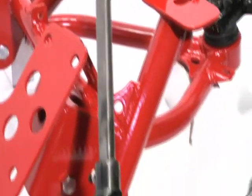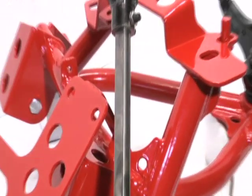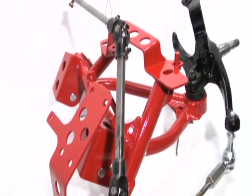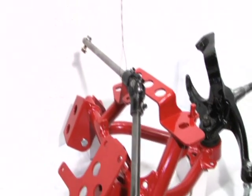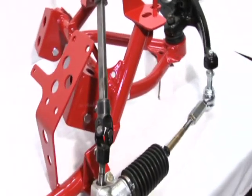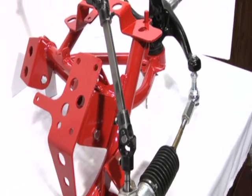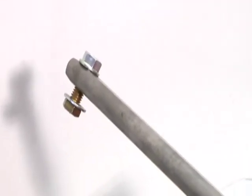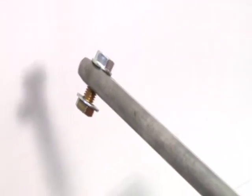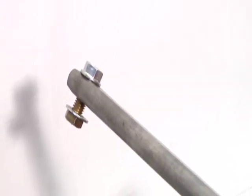We're using a 3/4 inch DD steering shaft, which is going to give you maximum header clearance. It's very low profile, yet very strong. This rack kit and steering shaft is going to give you about as much header clearance as possible on a 3rd gen. Really opens it up for you. Now on the top end of the shaft, it's drilled. This mounting hardware comes with. That slides right into your factory connection. Just bolted in place. Everything is a direct bolt on.